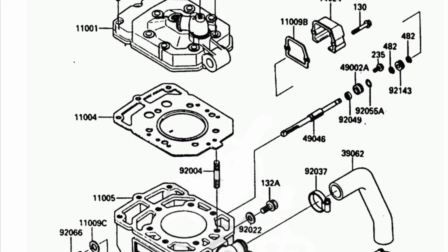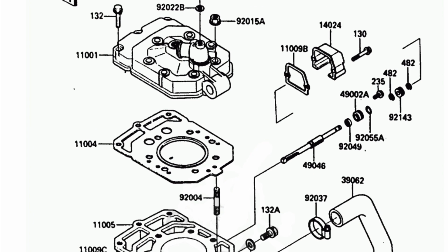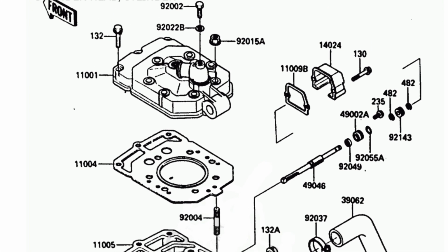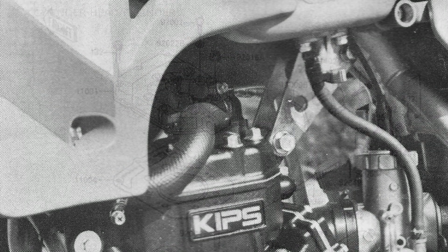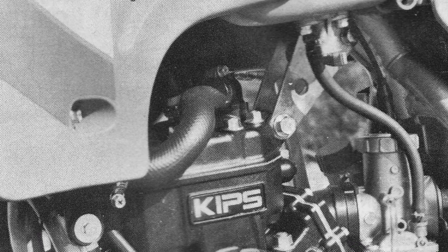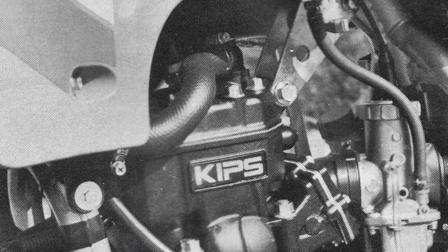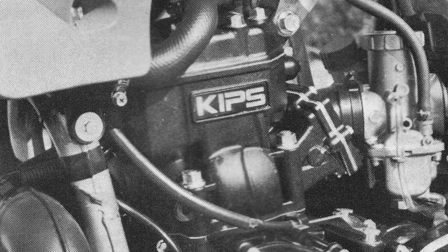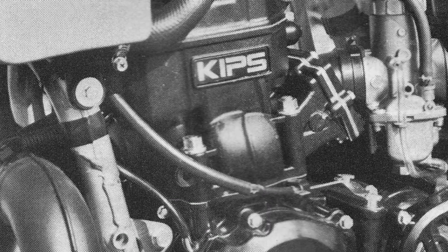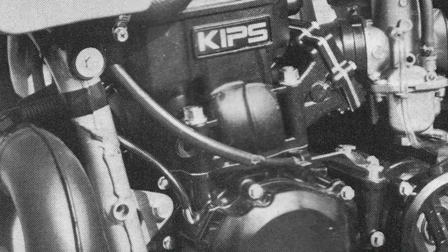New porting was added to match the redesigned motor configuration, and an all-new head was paired with a reshaped dome-top piston to boost compression to 10.6 to 1. Feeding fuel to the motor was an 8-petal carbon fiber reed valve and an all-new 38mm round-bottom Mikuni carburetor. This new mixer replaced the massive 40mm unit of 1986 and was said to offer improved intake velocity for quicker response.